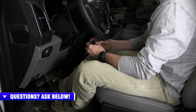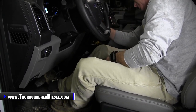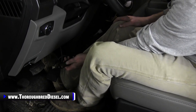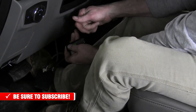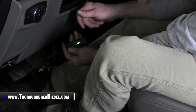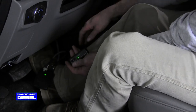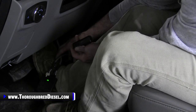Now we're in the truck with the module visible so we can see the light for connectivity. To get our wireless controller connected, put the key in the ignition and turn it on, then wake the remote up by touching one of the buttons — you'll see two lights come on. Press and hold both buttons until the lights start going up and down, then release them. When the lights start going up and down, push the throttle from zero to 100%, zero to 100%, zero to 100% — keep doing that until you see the green light come on the box. When the green light comes on, you're synced up and ready to go — you've got yourself a throttle sensitivity booster.